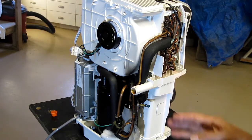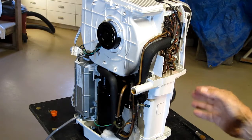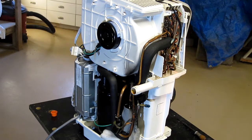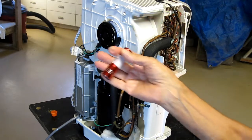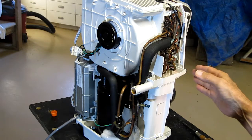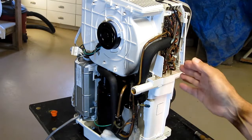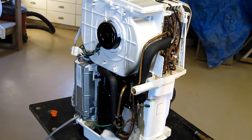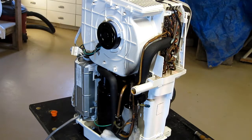The plan on the leak was — I was expecting the leak to be a little greater than it was, because the molecular weight of propane is less than R-410. So the plan was to use some fluorescent oil I got off eBay and a little UV flashlight, also off eBay — put the fluorescent dye in the system, let it leak down a little, and find the leak. I also thought about putting in some stop-leak. Well, it quit leaking. It's run several months now, fills its little bucket every day, no problems at all.